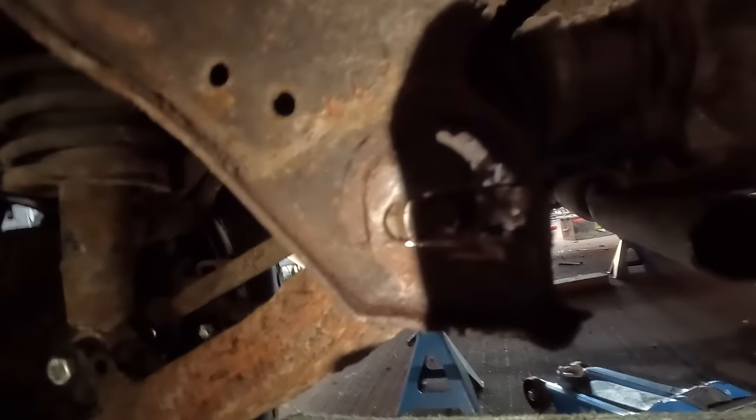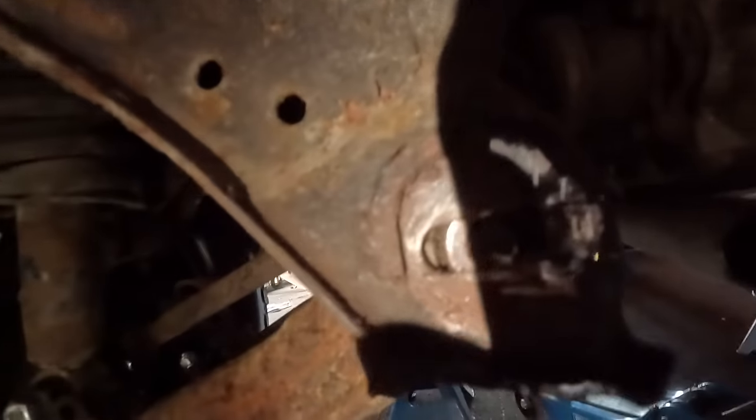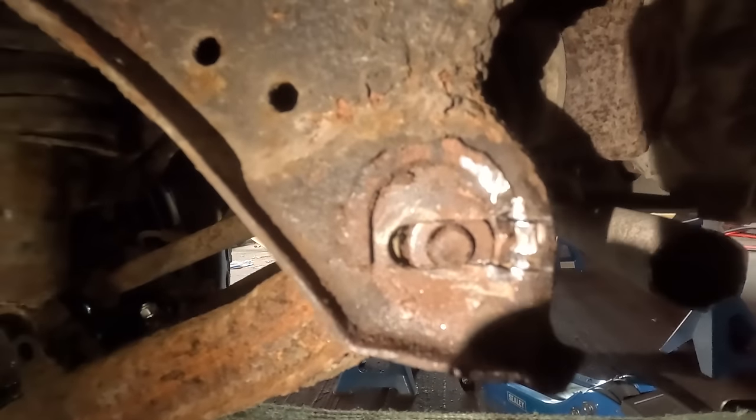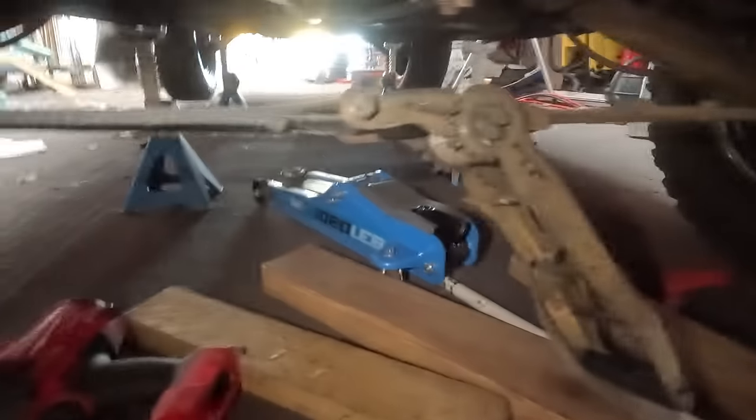Alright, well, I've come up with a plan here. I don't know if it's right, but it's what we're going with. And it is working, so it's probably going to upset a lot of folk. But we're cutting this, right? We're elongating this hole. This is what the boy John recommended I do as well. So we're elongating this hole so that bolt can slide further towards the exhaust pipe. And then, of course, we'll weld it up, and that'll give us our camber. And obviously, to bring the two together, we're using professional equipment, but we need a new Dremel bit because my Dremel's discs are all cut.